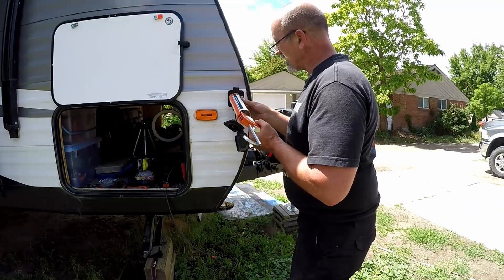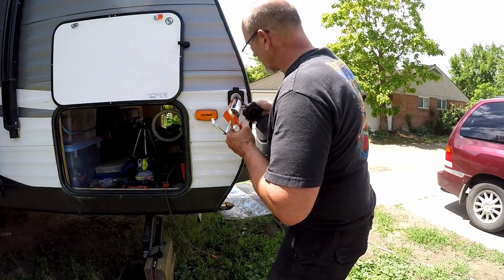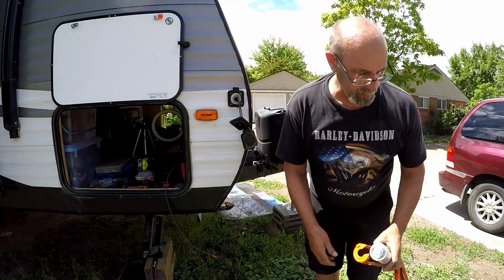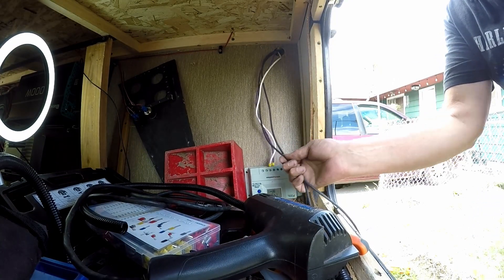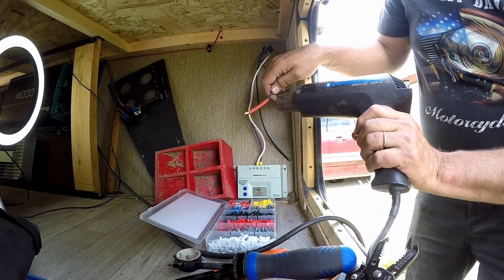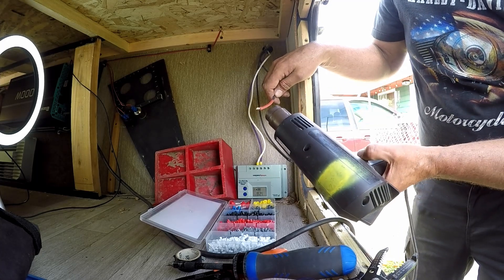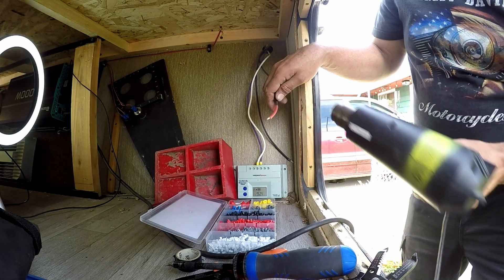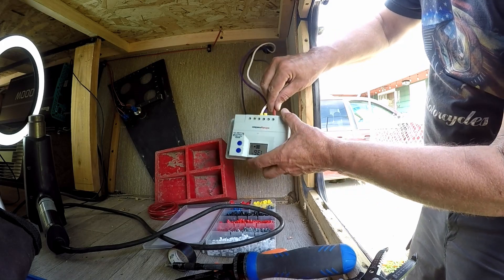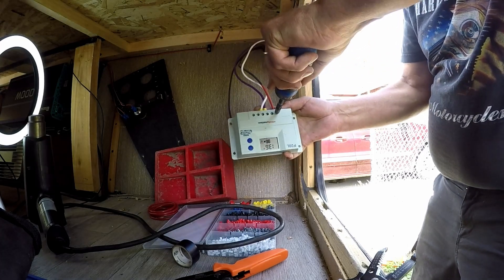This is silicone and it's designed for RVs — don't use just your hardware store style, it's not exactly designed for this application. I went around the hole that was initially cut for the plug, then put a dab on each one of the holes where the screws go in. Once I got that done, I came down and trimmed my wires up to size and put some more ferrule ends on. As you see right here, I put red shrink tube on there so I can identify the positive. On my trailer specifically, the purple wire going to the plug originally was the positive side. Most times — 99.9% of the time — white is going to be your ground side in your trailer. I say 99.9% because there's always a chance it could be different, so be careful and always use a multimeter when testing this stuff.